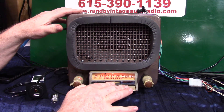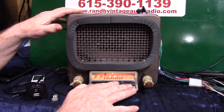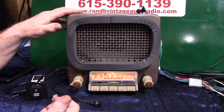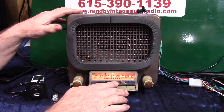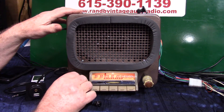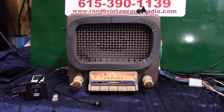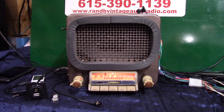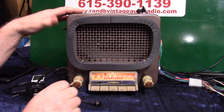I like these because they've got the little dimmer switches in them — we got that back. So you dim your light; you hook your light to your dash light so it comes on with your dash lights. If you're at night and you want to turn it down, you can run it up or down, but it will dim with your dash lights too. Most of these, sometimes the light comes on with the radio, but you've got to tear the whole radio down to change a bulb. I run it to the dash lights because a lot of these classic cars don't see night very much — no need to let the bulb keep running.